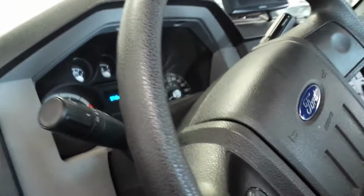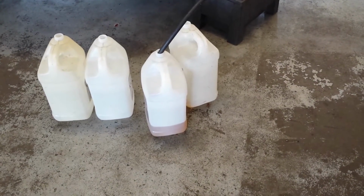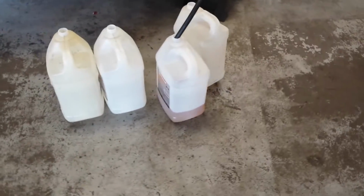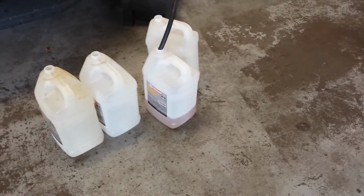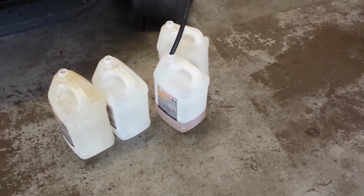I'm going to turn the key on and see if we have any leaks. I got a junction here, that looks good. A junction up there looks good. So the frame rail mounted pump's pretty good. Key runs the pump for 30 seconds, and that's a pretty good amount of fuel that came out of there.